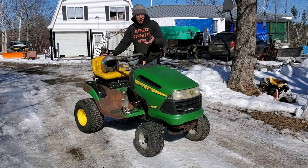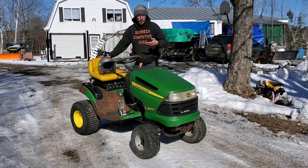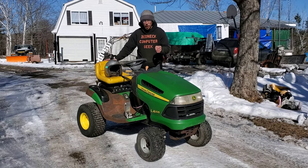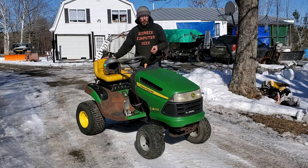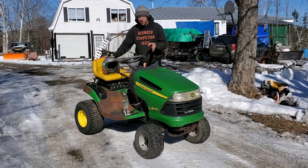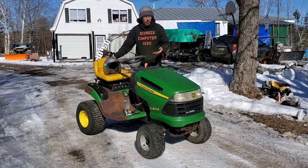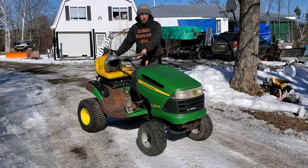I'll post up footage of me racing against Dan, who runs a red machine. He was the top racer in the second race and he's definitely one of the fastest. The interesting thing about ice racing is that Dan's machine actually has the smallest motor in the field — a 14 horsepower Vanguard — while multiple machines including mine are running 20 horsepower engines. But Dan's machine was geared perfectly. He sat in fourth gear, did about 25 miles an hour through the turns, and about 30 plus on the straightaway. That's what I need to gear this machine to do next.